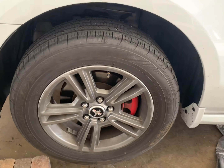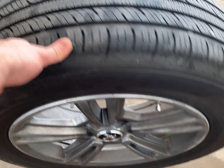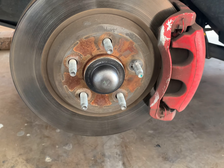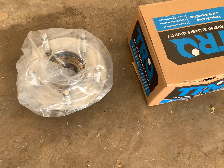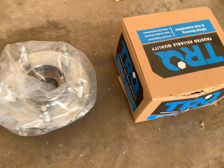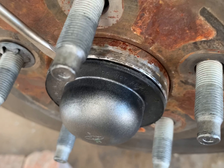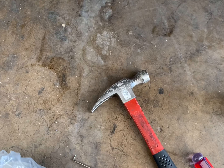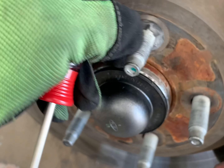Now to take the wheels off. Got the wheel off and now we're gonna need to take the brake off and that center cap and the rotor. Here's the new wheel bearing that I'm gonna be putting in — I got it from 1AAuto.com, I think it was like $90 for the pair. To get this center cap off, using a flathead screwdriver just put it in a little groove here and then hammering on the top, spinning it to get the next little spot just to get it loose.